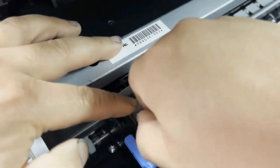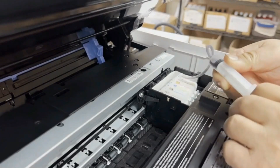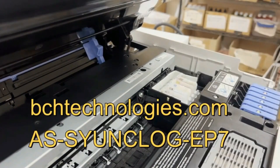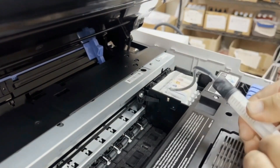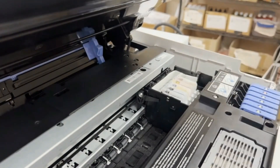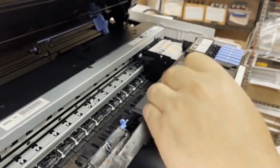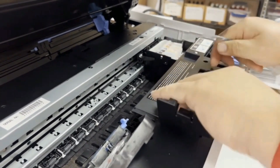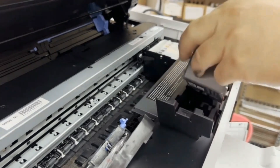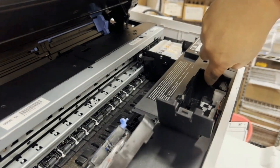We disconnect all the tubes. Now we can detach the assembly from the dampers. We try to suck ink out of each damper. I'll put a link to all the products we used in the description, with a direct link on the top right corner. There will still be a whole bunch of ink left in the damper, so now I'm going to remove it by parking the printer — the carriage on the capping station. By park, I mean you turn the printer on and wait until it rests on the capping station naturally. The outlet of the waste tube should be right here.